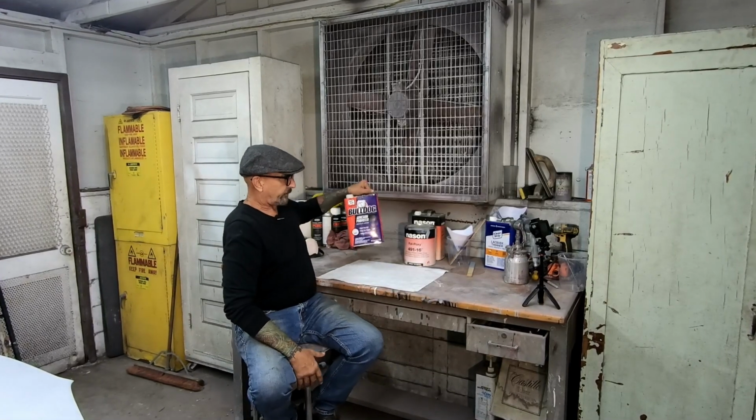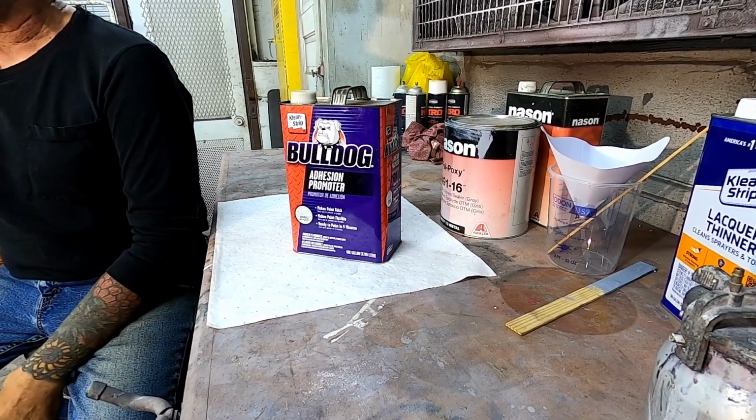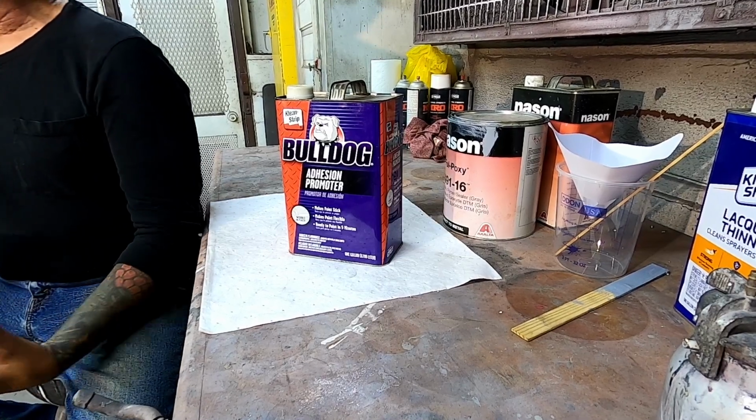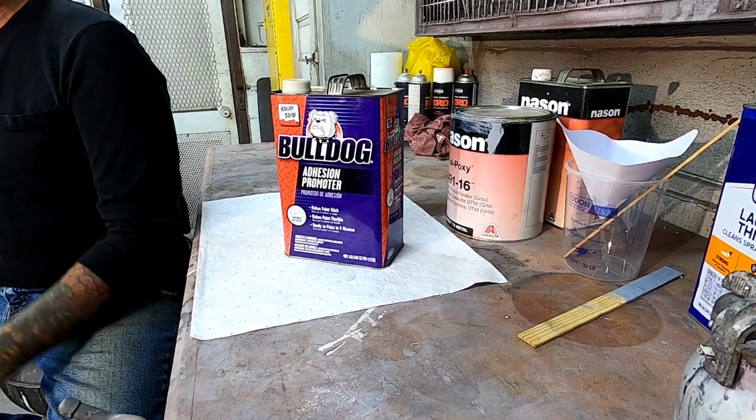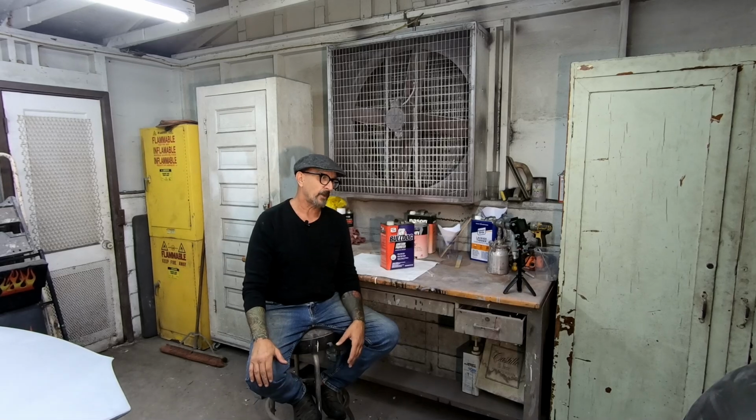If you've ever tried to paint plastic, you know how that can go. To avoid that, anytime I'm painting plastic or uncoated fiberglass, the first thing I spray on it is some stuff called Bulldog Adhesion Promoter. Again, I'm not sponsored, I have no commercial interest, I'm just telling you what works for me. This stuff is pretty cool. You don't mix it with anything, you literally just shake it up, pour it in a cup, and spray it on. Wait 5 minutes and supposedly you can top coat with the system of your choice.